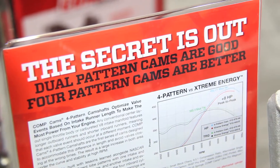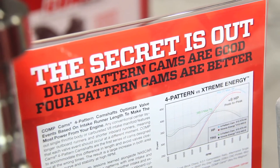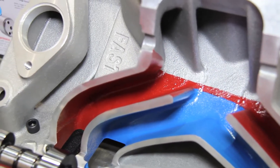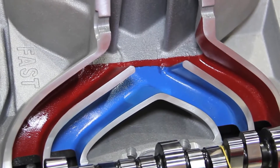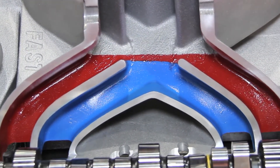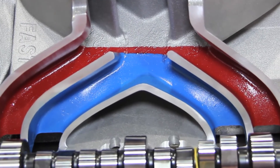The difficulty comes into play when you have a single four-barrel style manifold. On any V8 application, you've got two sets of runners that are short and two sets of runners that are long. Essentially, you divide the engine into inboard and outboard cylinders based on their location to the entry of air — which is a carburetor or a throttle body if it's an EFI application.